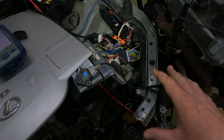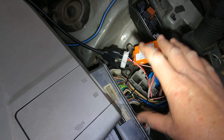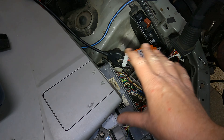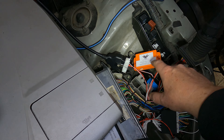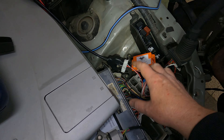There's no wiring in there for an auto at all. Because the Crown works on CAN data, not on MPX or the older-style Toyota system, we've got this box to convert the CAN to MPX for the vehicle so all the gauges work. Also, because it runs on CAN, it doesn't use the K-Line communication.